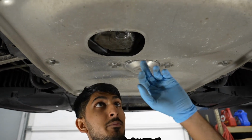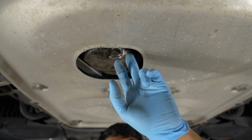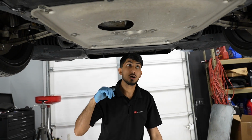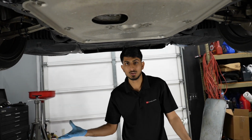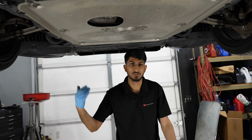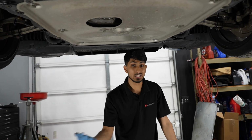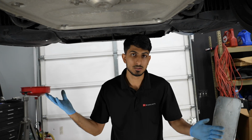And it has to be a BMW, right? So we've got some oil residue, oil buildup. When we're upgrading the crank hub, we have to remove a lot of this stuff. So the oil pan comes off, all of that. That's also part of the reason I've been waiting on doing a lot of the maintenance, because now that it's at 60,000 miles, it's going to need a lot of the stuff. So valve cover, it's going to need spark plugs again. They should have been changed at 30,000, and now it's going to need them again. And when we do that crank hub, all those seals, everything is pretty much going to get overhauled. And we'll have DIYs on all of it. So it's a win-win for everybody.